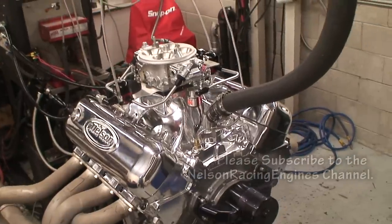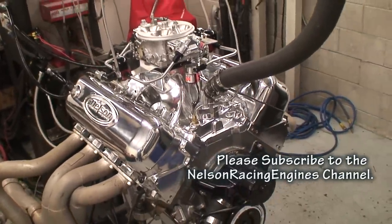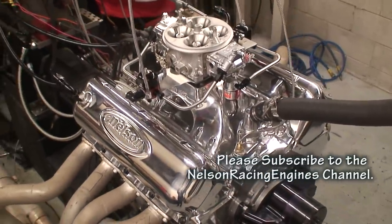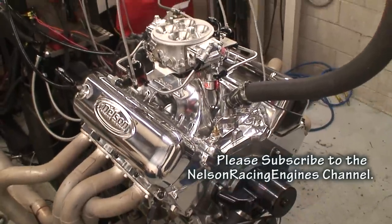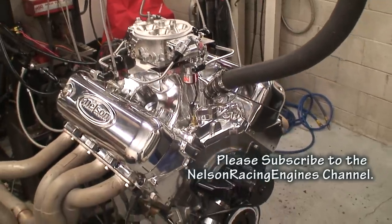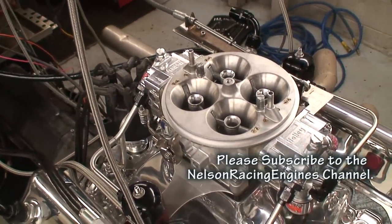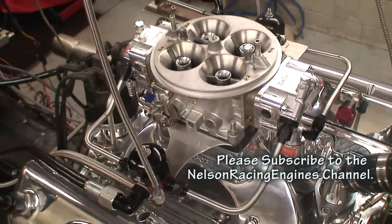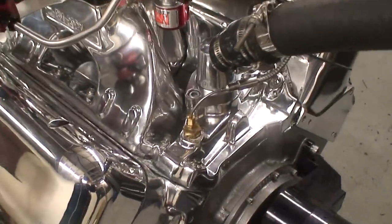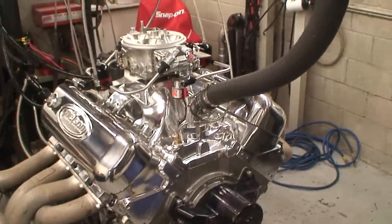1127 foot-pounds, 1080 horsepower on a bit of spray — really rich and safe. Really good looking piece, sounds mean as hell. It's gonna go in Gary Williams' Nova. I'm a Nova guy myself, so a little envious right now. Take a look at the nice Dominator carb — the carb shop makes this custom for this engine, billet boosters, some of our billet valve covers, VM2027 single plane manifold. That's a monster — just a really, really nice package.